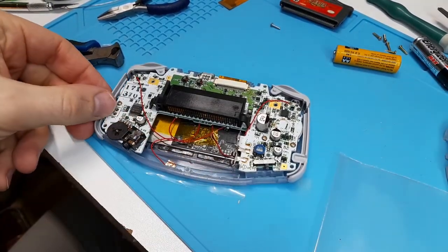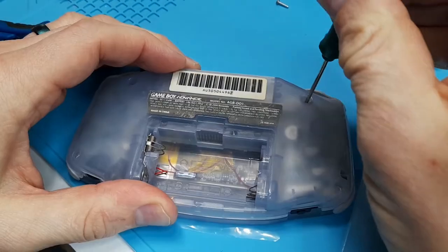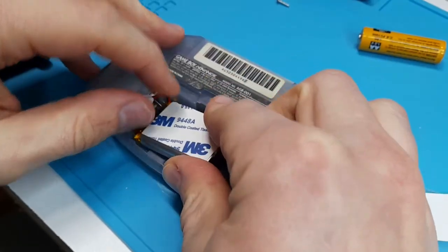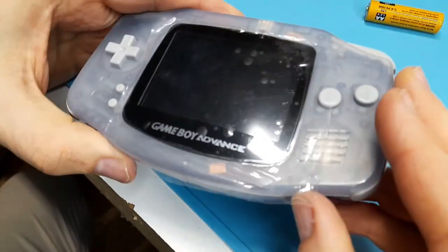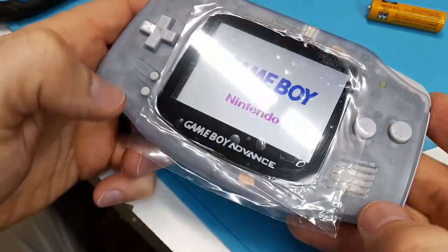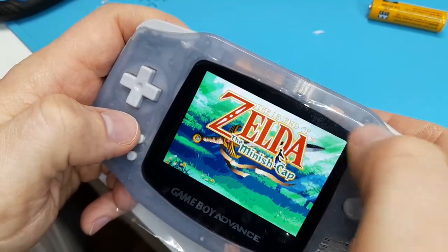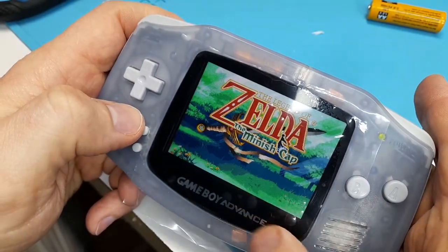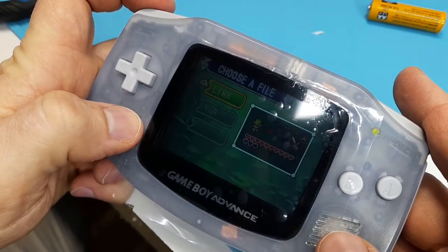With those wires soldered on, we're done putting in the IPS screen. Reassembly is just the opposite of disassembly. I'm trimming the back shell because I'm actually putting a rechargeable battery pack in this Game Boy. When the back shell is on, return the seven screws — to prevent cross-threading, turn it counterclockwise until you feel a pop or click and then screw it in. I'll leave a link in the description for the screen I use as well as the rechargeable battery. The screen protector is just a sticker — take off the back and stick it on, and don't get fingerprints on the back. Once you have it reassembled, pop in the game and test it out. For V3 screen folks, test the touchpad up top for color change and the bottom for brightness control. If you have a V2 or included button control, hold down select and hit the left and right triggers to test your brightness control. Load up a game and ensure that every single button works.